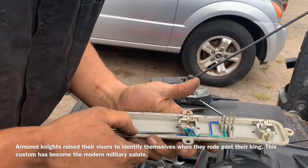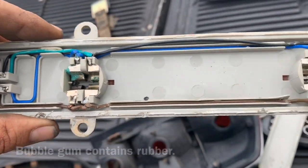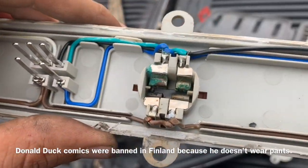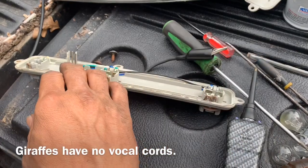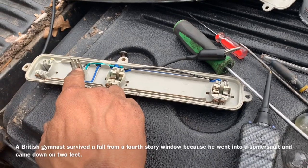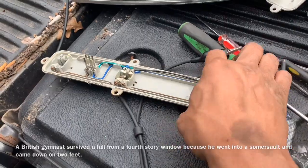It's apart! Observing down in here, we need to get all this corrosion out because it's causing an impedance problem and not allowing the current to flow properly. This one's not so bad but we can clean it up. There's some melted plastic down there we're going to take out. We want to check and make sure that these wires are sending signal to the appropriate post - we're going to hook our ground up from our Power Probe and check for continuity. You can do this with a test light or any kind of multimeter.